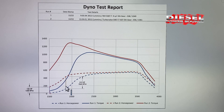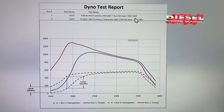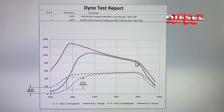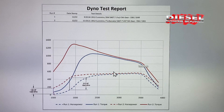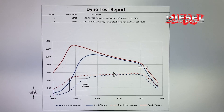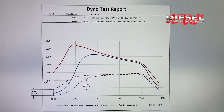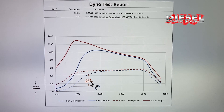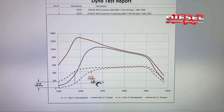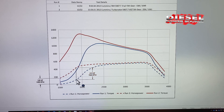I've added some measurements here on the graph to help you better understand the comparison. Notice overall that the VGT at the peak did have 18 more horsepower overall, but the big difference is down in the lower end. The biggest difference was with the VGT at 1865 RPMs — it had 312 horsepower more. The only change he made was adding the VGT housing to his BorgWarner S467.